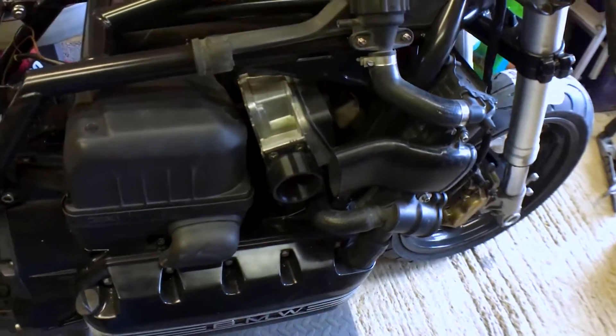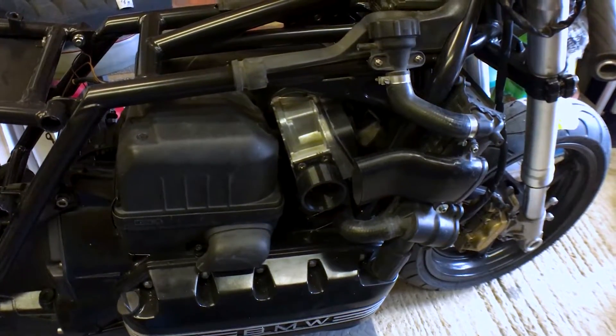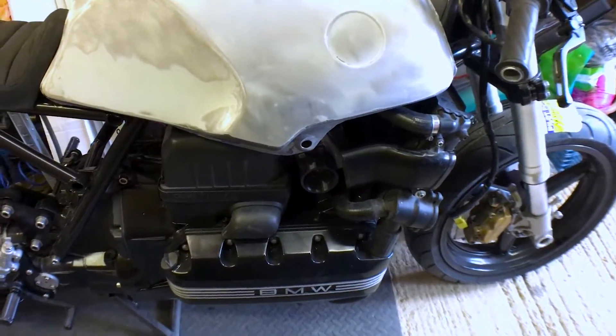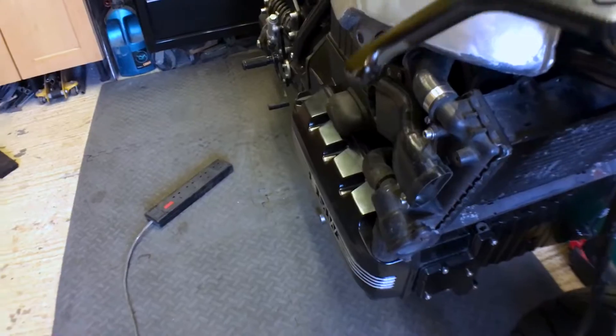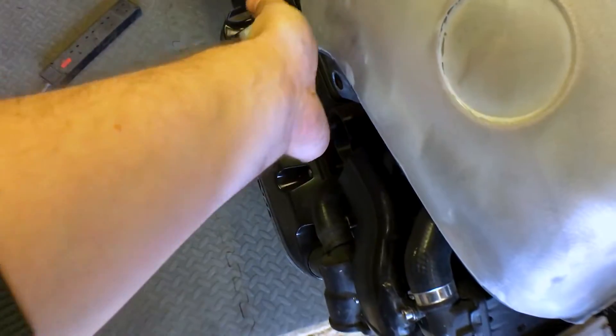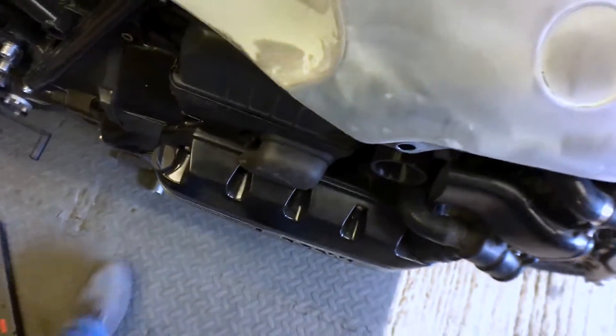This is still quite long — I can just remake this and make it slightly shorter, it's quite easy to do. Or I could actually have a cut out here to allow the air in, and then I just need to get a filter that actually has a short lip on it. Then we'll actually be getting more or less ram air, which is pretty cool. So I'm just going to put the tank back on, see how it all lines up, and carry on from there.